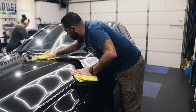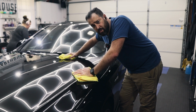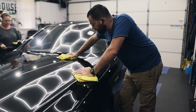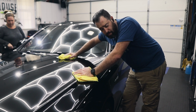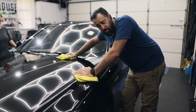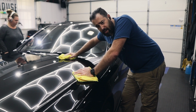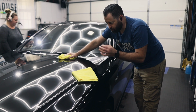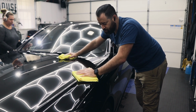Now, what if this was hard paint? I think we're kind of fortunate here because the paint is pretty soft and easy to deal with, easy to work with. We don't have to use anything more aggressive. But if it was harder paint, well, maybe we would switch our pad, or maybe we would simply use a more aggressive compound. The NSP polishes have 3 grades, so 45, 95 is their medium, and then 150 is their compound, basically.